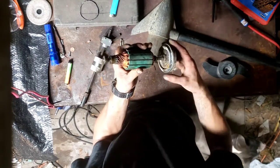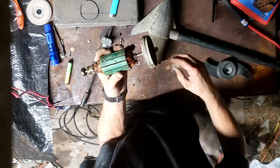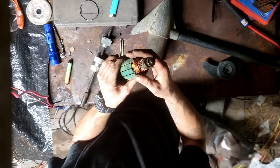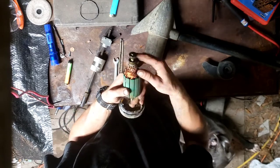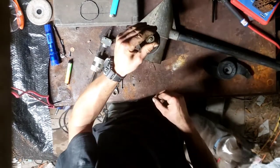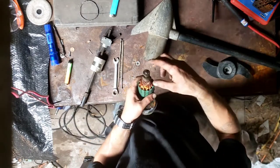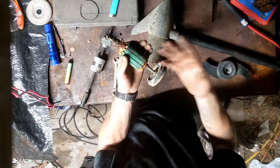Right away, this looks fine — let's clean that up. Make sure the bearing is all lubed up good. From what I can tell, the windings are all okay. If you see something burnt, then obviously there's something wrong. You can test your windings by checking them with an ohmmeter, but usually they're fine unless you see something visually wrong with it. If you do see something visually wrong, then I would test further. If you need help on how to test that, leave a comment and I'll help you out.